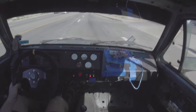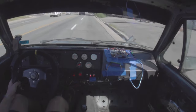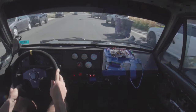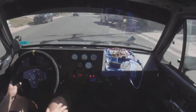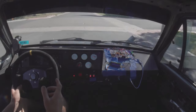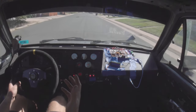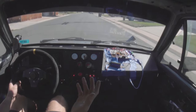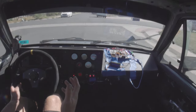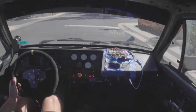That's pretty fun. I think the other thing this car could benefit from is probably just more boost, which will make the overheating problem even worse because my intercooler is in front of my radiator. So if the radiator got all the air right now it might be okay, but it's getting not just less air — it's also getting hot air from the intercooler going through it. For now, this timing worked out pretty good, and I'm happy with that.